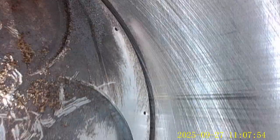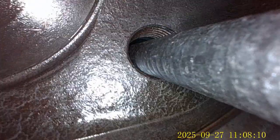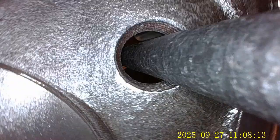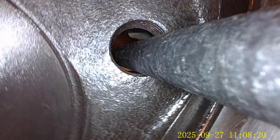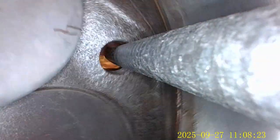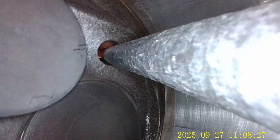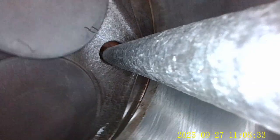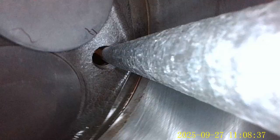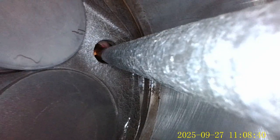There's a cool little picture — you can see the quench there, where it's probably getting close to the head. Let's take a look up top with that 180-degree articulating. There it is — you can see the head gasket right there. That's the spark plug. You can see the valve — that looks like the intake valve. There's the exhaust valve. That looks like it's open. They're close there. You can almost see the margin of that valve, and then you can see the head gasket there.